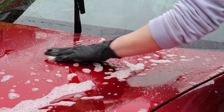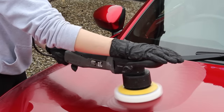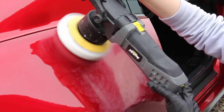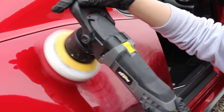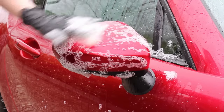The next mistake is claying and polishing as part of a routine rather than assessing whether the car actually needs it. Clay is abrasive, so it's likely to cause some level of marring, and if you want to properly correct that, the car will need polishing. Polishing removes a fine layer of paint to flatten the surface and remove damage, so there are only so many times you can do it before you run out of paint. My own MX-5 only has about 80 microns of paint, so preservation is really important.